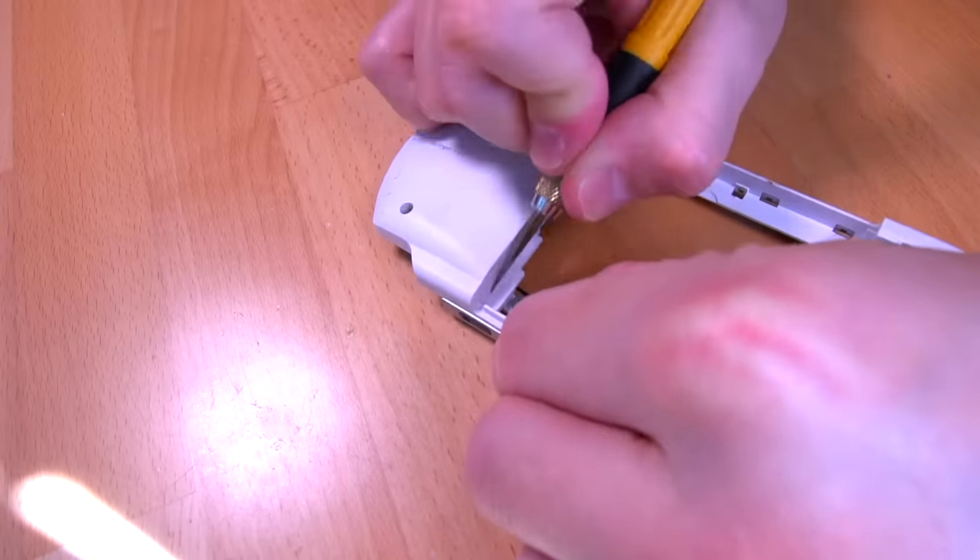Next we need to remove the IR receiver. The way I did this was by applying some solder and attempting to lift it off; another way would be to use hot air. Once it's removed, go ahead and cover the pads with some Kapton tape. Next, in order for the kit to pull audio from the PSP, we'll need to solder three wires to three small ceramic capacitors — this is a pretty delicate job so take your time. Red is for the right audio channel, white is for the left, and black is ground. I re-soldered the white wire so it goes upward to help get it out of the way of the mid frame once reinstalled.